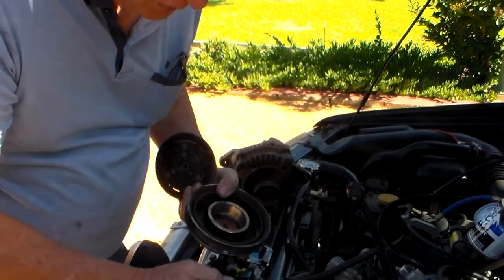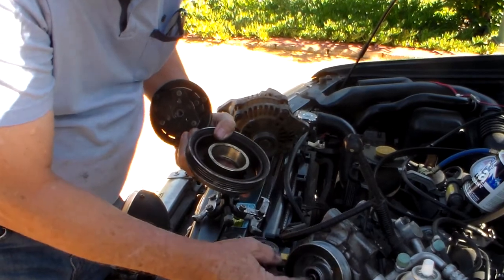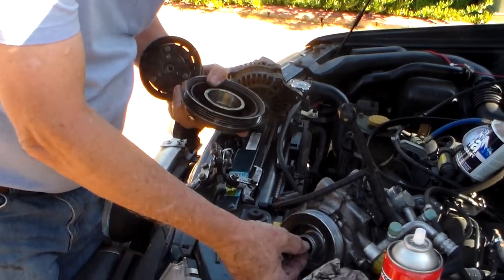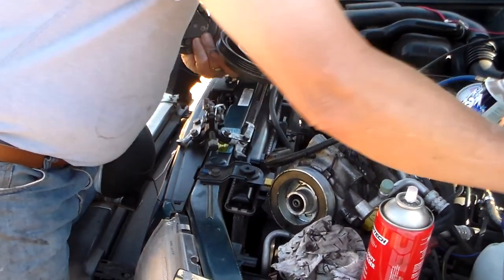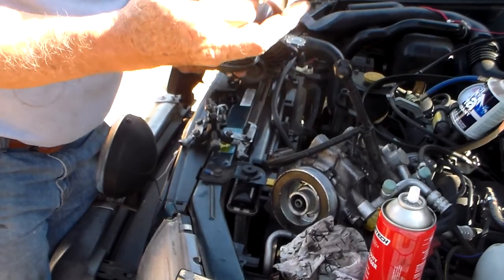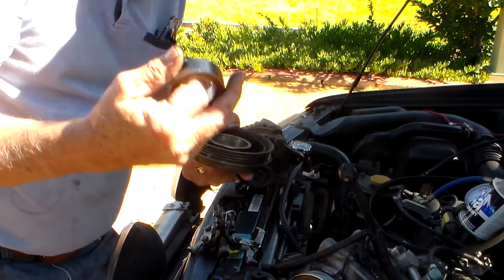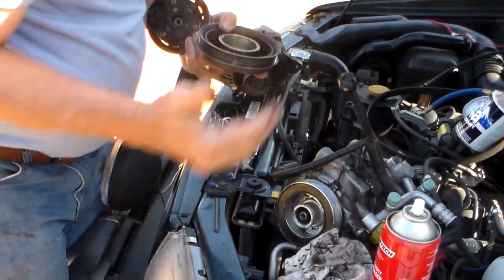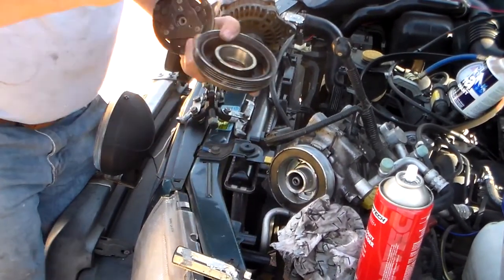When I did take it apart, inside this shaft here there was a lot of small filings, all piled up in a magnetic sort of hole. So that's what made me think it was this bearing. It doesn't seem too bad — it's gritty, fairly gritty — and I think it's breaking down, and the bearing is locking up every now and again, and the belts are screaming. It's just pulling around on it because this is not working.